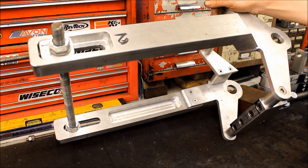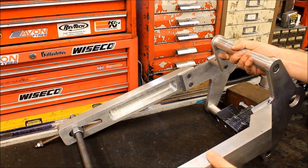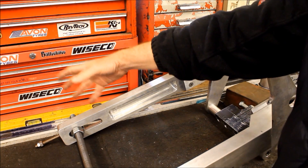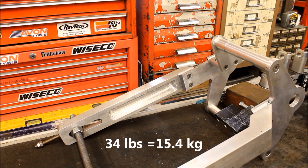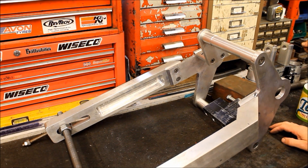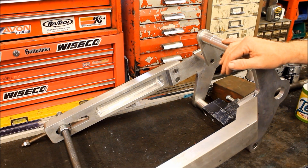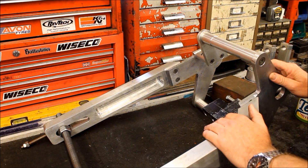I think it's looking pretty damn good. When we started this I didn't even think it might work. We just weighed it and it comes in at just shy of 19 pounds, which is a bit more than I thought, but we've also got the weight of this heavy temporary bar bracing the back end before it gets welded, so we'll lose a pound or two there. Compare that to 34 pounds for the original steel swing arm - we're looking at roughly half the weight. It's heavy for a sports bike swing arm but it's very light for a Harley softail swing arm, and it's going to be very strong too.